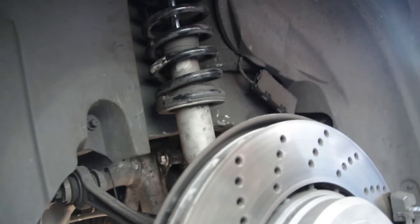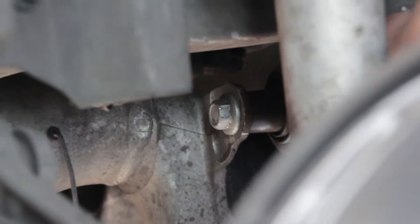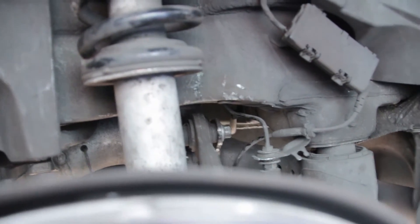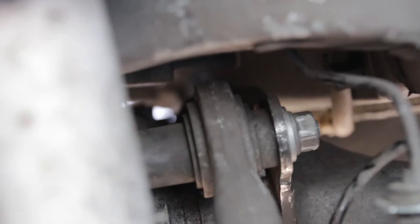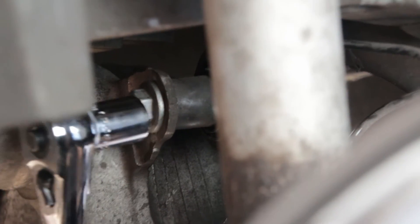You're gonna have to push the entire strut towards the car and it will pop right down and become loose like that. The next thing you need to do is loosen this arm back here, which I believe is an 18 and a 21 if I recall correctly. It's really tied up in here — it's the one I'm actually a little worried I might not be able to get to. It's an 18, okay that's kind of nice. Easiest way is an 18 wrench and 18 ratcheting. Safety tip: jack up your car safely.